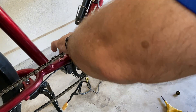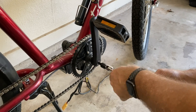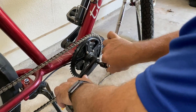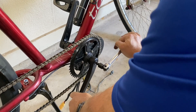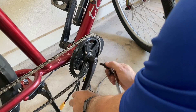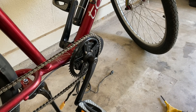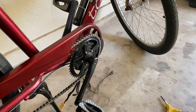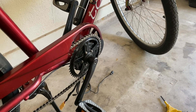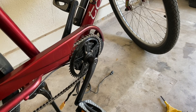The next thing we'll do is reinstall the chain. My chain is attached to a three-speed internally geared hub — I don't have a derailleur in the rear. I don't necessarily recommend that because it's a little bit weaker than the traditional rear that comes on the Townie. I probably need to clean my chain too, judging from the grease that came off on my hands. Now we can reinstall the drive-side crank arm — be sure you get it good and snug and recheck it after riding. I'll also reinstall my chain guard and this part of the assembly will be finished.